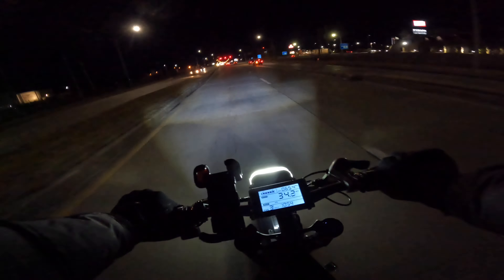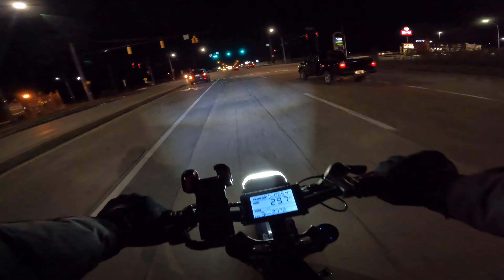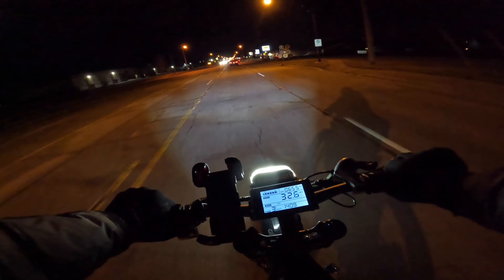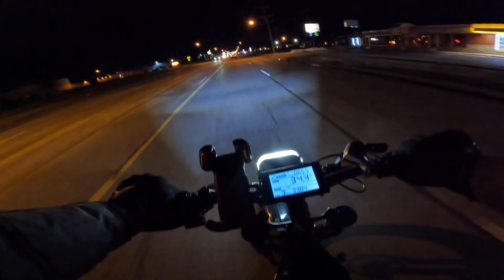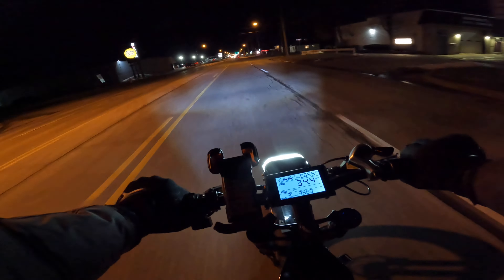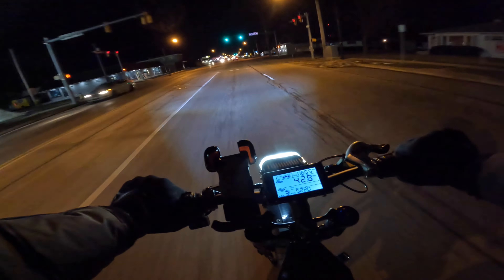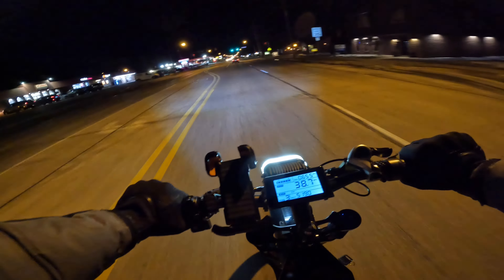That's one of the reasons I stress that when you're buying a bike, make sure they're using 21700s. People are moving away from 18650s toward 21700s, and that's the way to go because you get overall more capacity. Going from 35E to 50E cells, at 5P you get 25 amp hours. Even at 4P you still get 20 amp hours — two and a half more amp hours than with 18650s. Get the best battery you can because you get more efficiency and performance out of it.